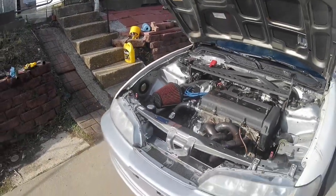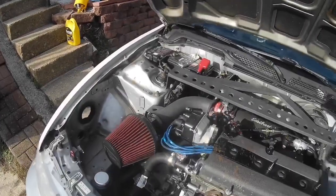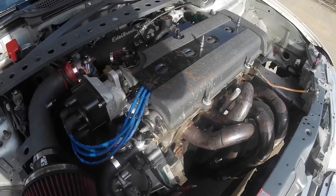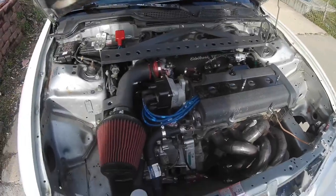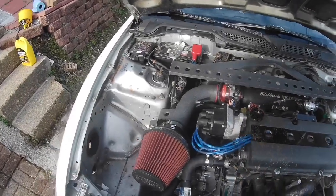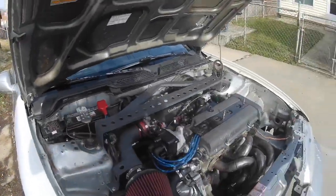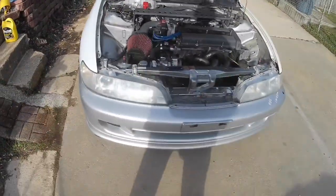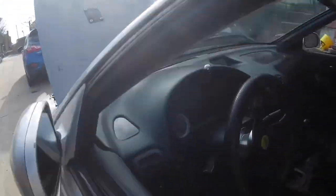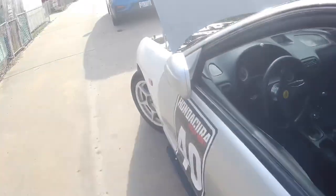All in all I'm happy with this install. The hardest part was getting the filler neck and upper radiator hose situated, but you could have just done a little hose off of here with the inline filler neck and then get a hose to come down — I decided to get it welded and make it one piece. There's no stock top radiator hose for this, you just have to find something that works. If you're using a B16 head or a GSR head, the Deco hose with the part number I mentioned earlier in the video won't work for you. Hopefully this keeps coolant temperatures down — the dual fans came on, everything's working, and it's reading about two ticks past 90 degrees Celsius, which seems like a good operating temperature.